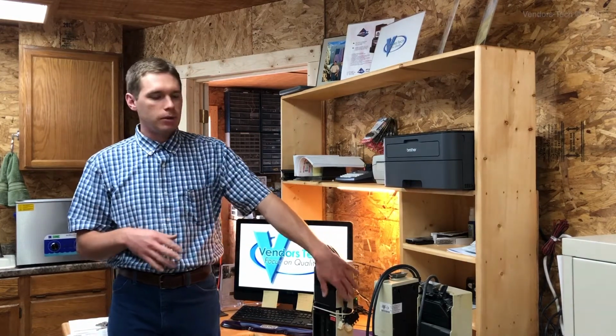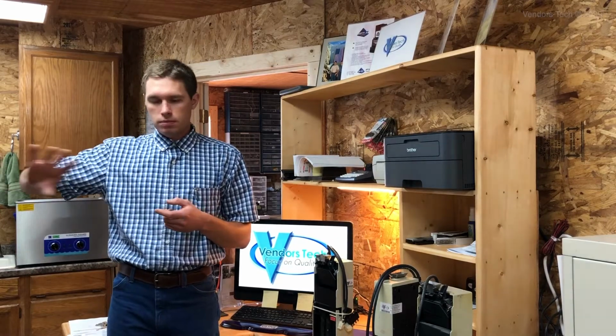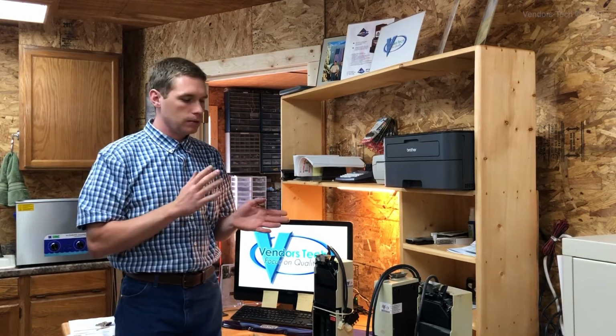That doesn't mean you have to go to MDB, okay? You don't have to, because we've got single price coin mechs, we've got 12 pin 110 volt micro mechs, we've got 24 volt 15 pin and 12 pin TRCs. We have MDB TRCs as well, which, if you have an MDB TRC like a 6512 or 6510, the next time that thing dies or has to come out of the machine for any reason, phase it out. Put it in a pile and sell it to us for parts, or throw it on eBay, or just toss it, because it's not worth your money anymore to invest in the TRC series coin mechs. Move to the CF7512, the MEI CF7512.